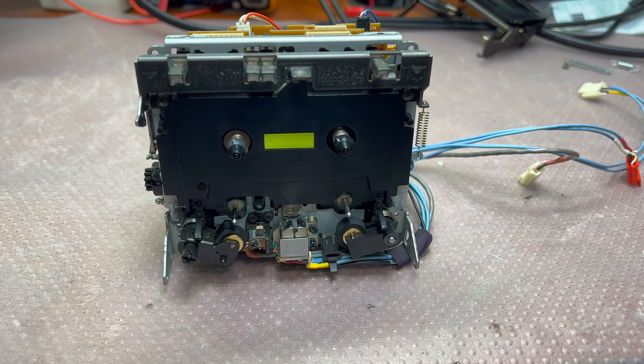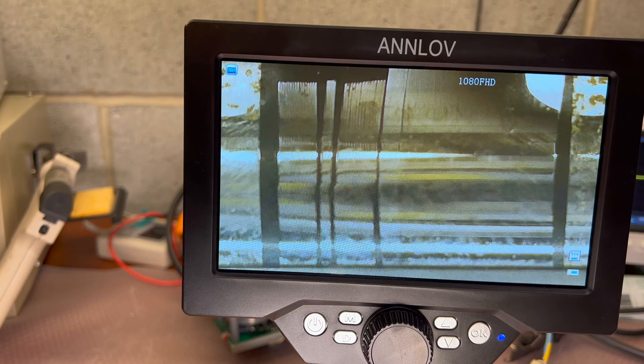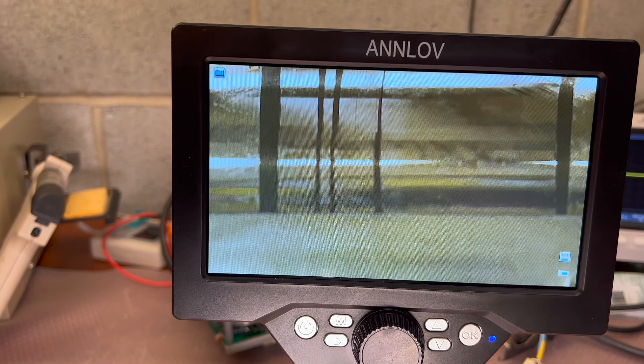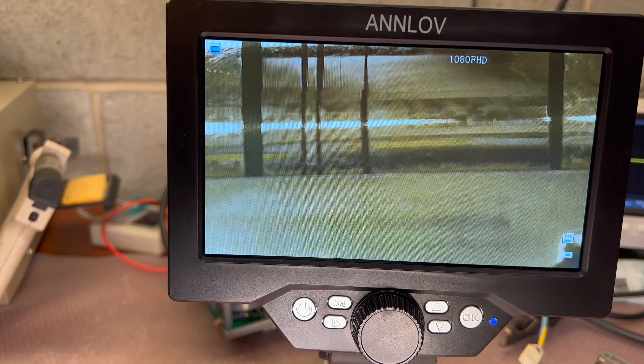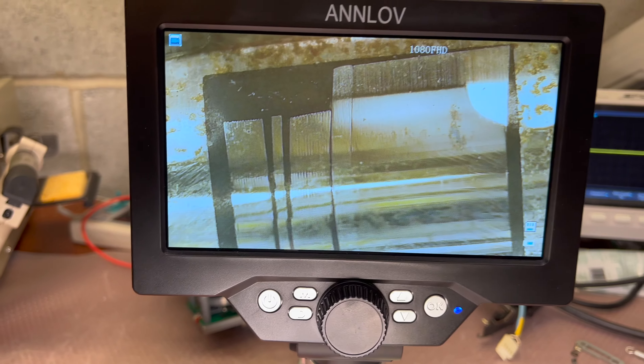Here you may see how this head looks under the microscope. This is the record head — you can see on the right side there is a groove and multiple holes. I believe this may not allow the tape to go straight over the head. And here is the playback head — even if it looks small, it's already scratched a lot. Let me polish it and I'll show you the final results.